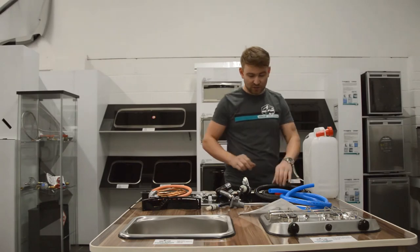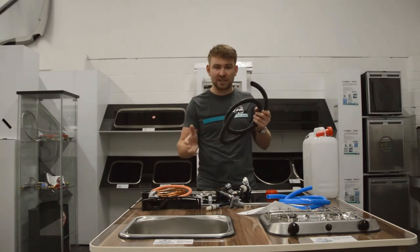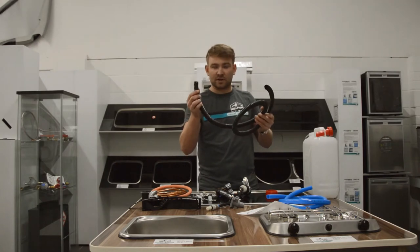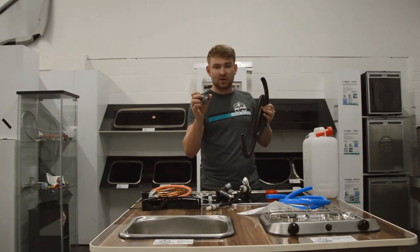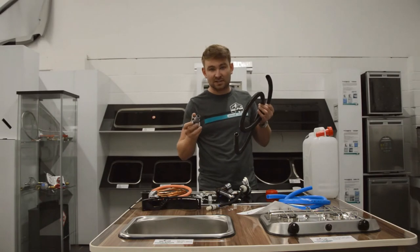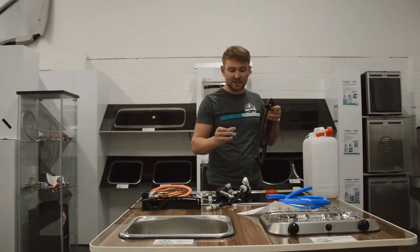Finally, we'll have a quick look at the waste. All the sink hob combination units come with a three-quarter outlet for the waste. Supplied with jubilee clips and p-clips to make it nice and easy, you come off your sink hob combination unit onto the outlet. The waste outlet runs to the outside of the vehicle, though some people may not want to bring it outside, in which case you can add another 10-litre water container to collect your waste water, all inside the vehicle.